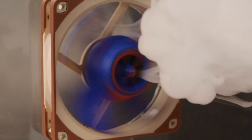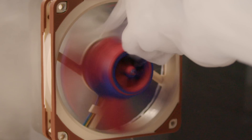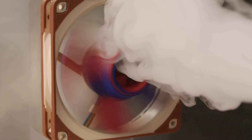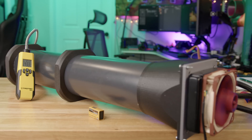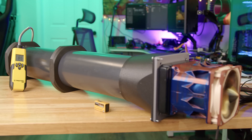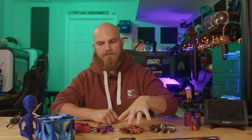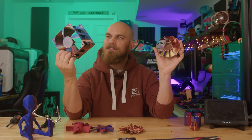From the looks of it, that little tiny fan in the center there is doing exactly what Hang hoped it would. As for the flow testing, before we get to the cheater and see how it does on this new setup, let's check out these four new ones. The Hollow Man came in around 435 feet per minute. The Waterfall came in around 423 feet per minute. The Circumventor came in around 397 feet per minute. And the Warhead came in around 454 feet per minute — placing the Warhead in first, the Hollow Man in second, the Waterfall in third, and the Circumventor as expected in fourth.